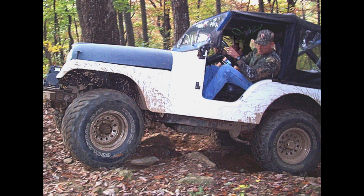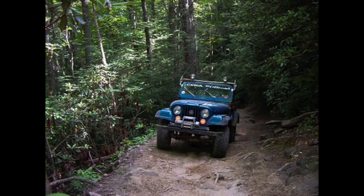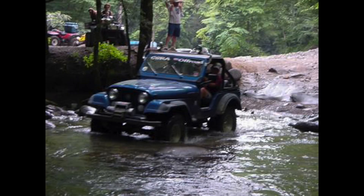I put a locker in the rear axle. I had to drill out many of the bolts — Jeep likes to use Torx screws on everything, and the ones holding the rear diff cover on an AMC20 rear end — there are like a hundred of them back there. I drilled out some of those and put hex bolts back in. I also had to replace the clutch. So yeah, it was a big project.